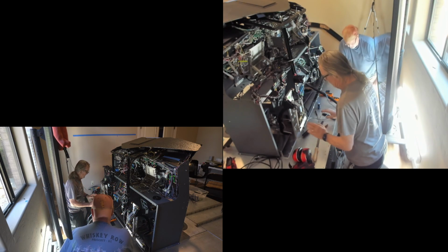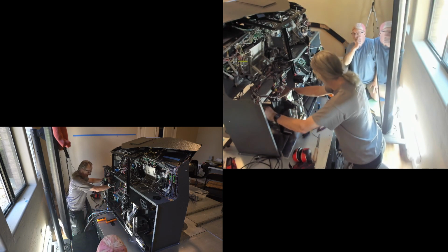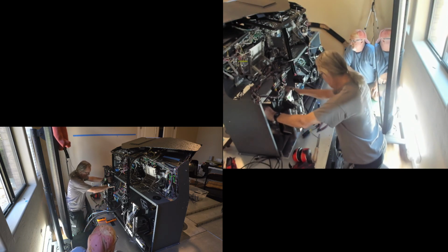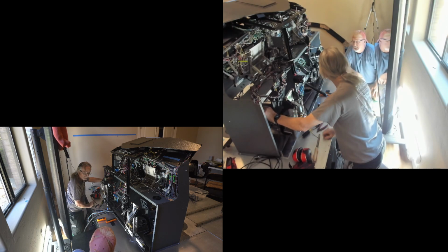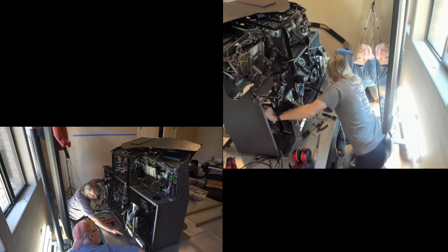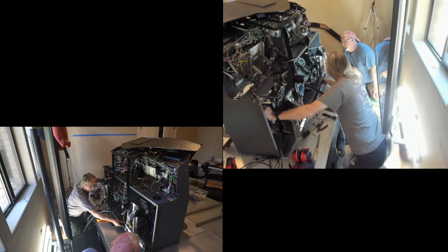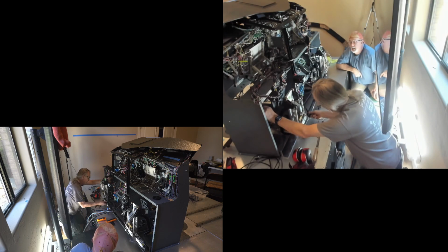So we got the network box in there. The other thing we did was, between the 2 rudder pedals there was a crossbar. So when I moved this pedal, that one moved. It has a crossbar, and we installed that. It was really messed up with corrosion and rust, so I hit it with a wire wheel. Right, this pin here. I put lithium grease in there, and you don't want to tighten all the way. You should have a little bit of play in it. Just a little. Actually, this one's a little too loose right there.